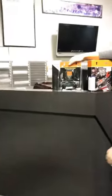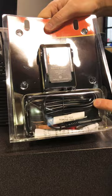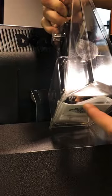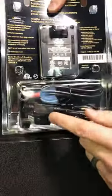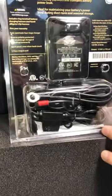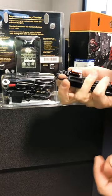If you have a pre-2016 bike that doesn't have a battery tender on it, I'll show you what we've got here. That's your base model battery tender — comes with two leads. One similar to what we just saw that mounts directly to the battery terminals, and another one with alligator clips that'll go on your side-by-side, riding lawnmower, anything with a larger battery you want to keep charged. And there's a fuse in here — it's an inline fuse, same 7.5 amp fuse as on the bike, so if you get a power surge it'll blow that fuse and you won't fry your electrical system.